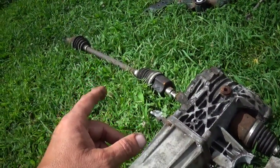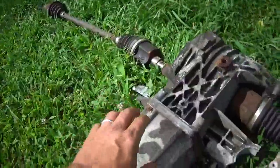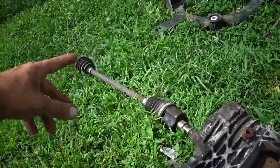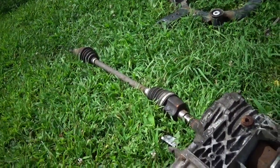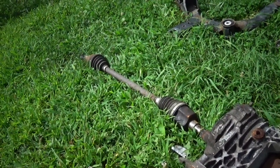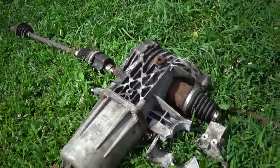From this point on it's not going to have any traction control whatsoever, even on the front, because it's disabled. As far as the ABS, I don't think it's going to affect that. Right now the ABS is disabled because I paralleled this to one of the speed sensors, and I think it's messing with it. Once I get rid of the parallel thing, I don't think it will affect the ABS — but I could be wrong. So you might end up with normal brakes after this.